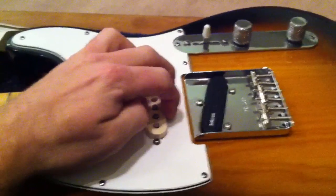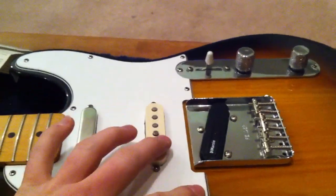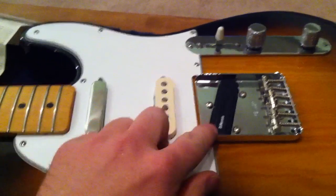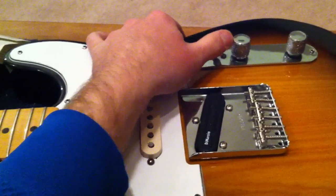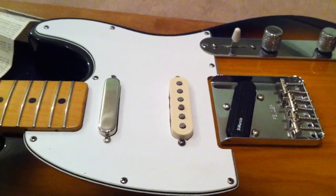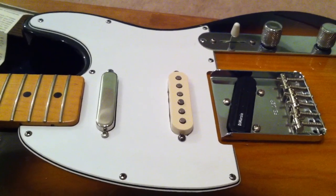Pretty much got it all put back together. I had to hollow this out a bit more so that my pickup would turn — it's really tight in there — but I got the screws back in. Pretty much all we have to do now is restring it, set the height on all the pickups, and make sure that in all switch positions the volume level is pretty constant. That's what you do last after you've got it restrung. Thanks for watching — hope this was a good tutorial and beneficial. Don't forget to rate it, check out some of my other videos, and pass it on to your friends and family. Thanks for watching!